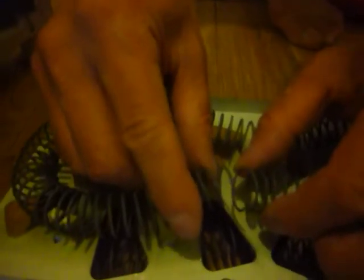This is the heating coil. Examine it — this side looks fine, there's no problem. But back here you can see this side has a problem: the element is broken. That's why there's no heat.